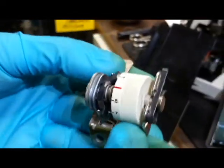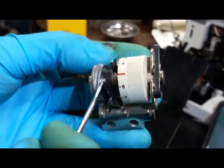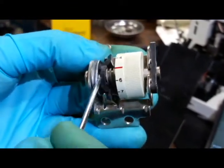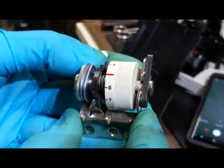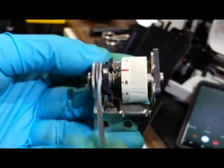The problem, though, is that we found oil varnish. This is a steel cylinder. It slides on a hardened shaft. It had oil varnish so that when it was lifted up, it would actually stick and not come all the way back, so that the discs were compressed tight.